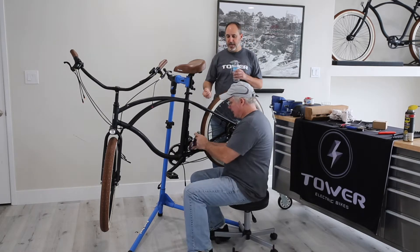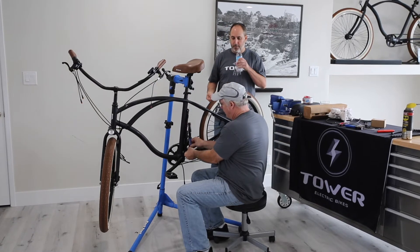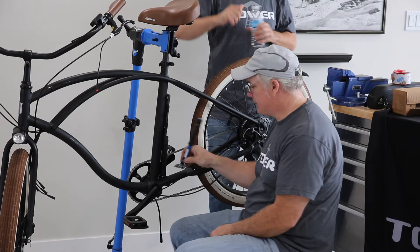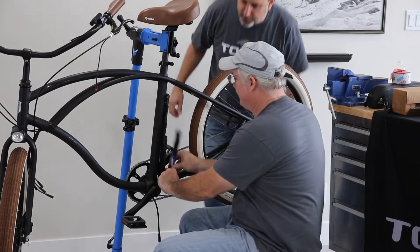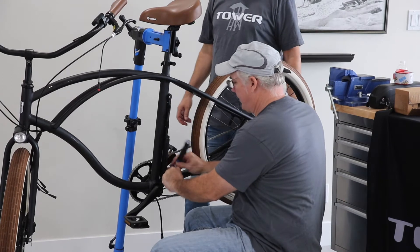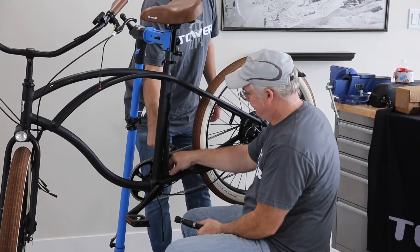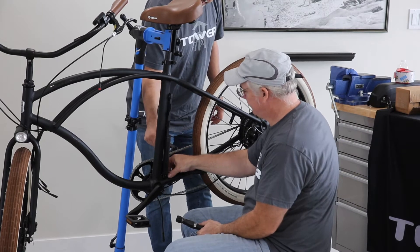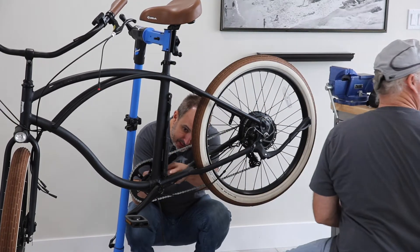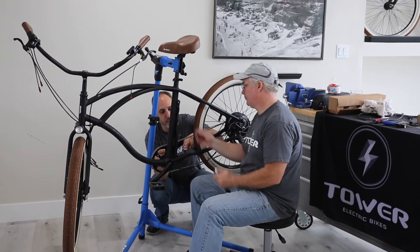This is a really easy segment, but the bolt down here is really sort of hard to get to. So what do you recommend for getting to that bolt? The short ratchet — the small ratchet with the 4mm — is the easiest way to get to this bolt. And it's a 4mm hex? Yeah, it's six-sided. A lot of our customers will have problems with this hex at the bottom, just because the angle of it is kind of funny here. So you've got to get the right tool. If you're trying to use a regular tool, it's going to sort of drive you nuts.